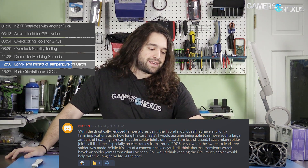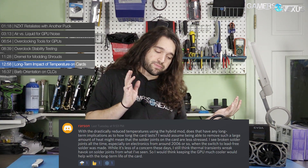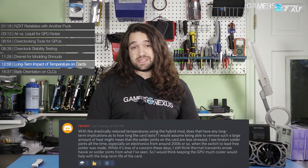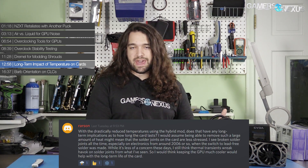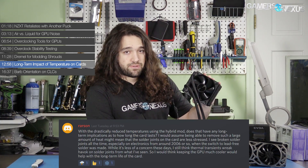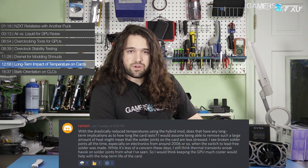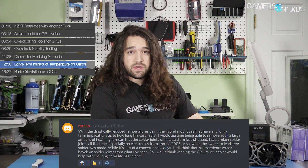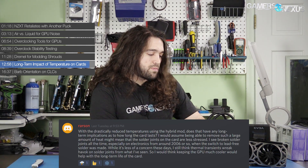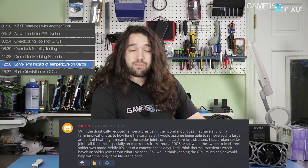Without a large sample size, a long amount of time, and a lot of equipment, it's basically impossible to answer how long a liquid-cooled card will survive versus an air-cooled variant. That said, I think both will probably outlive the usable life of the system — if you replace every five years, the reference or liquid-cooled card will outlive that service life. The one exception might be the radiator itself, which you'd probably replace around five years. Running cooler is generally better for most components, except things like NAND flash. How much better? Hard to say.